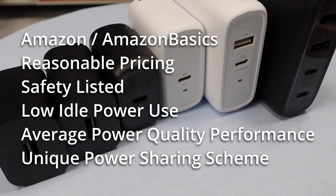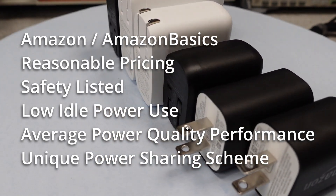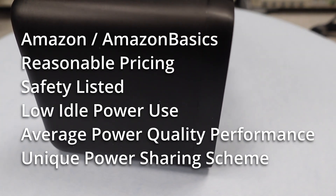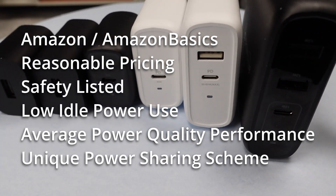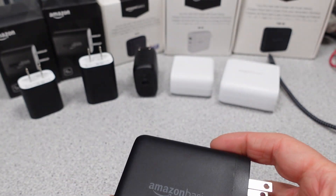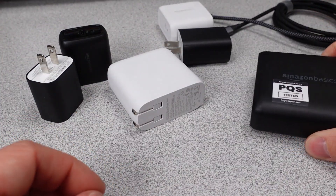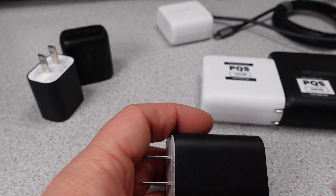The Amazon Basics power adapters do have one thing in common: the price point. They are all very reasonably priced for what you get. They have a very different power sharing behavior than many other power adapters. The 100-watt is really the same quality-wise as the Anker 100-watt 736, but at a lower price point. I'm not sure who is actually making these, but being in line with the competition is important and they are doing that. For the 30-watt and the 65-watt, they are tied for the best spot, but they don't have the PFC I'd like to see. No one has booted the Baseus 100-watt adapter out yet. The PQS for that adapter does drop to 150 when on 230 volts and 50 hertz, by the way.